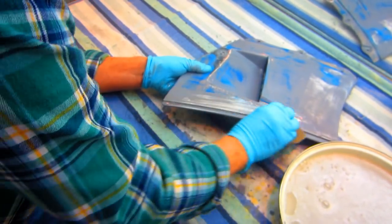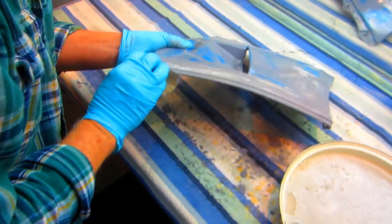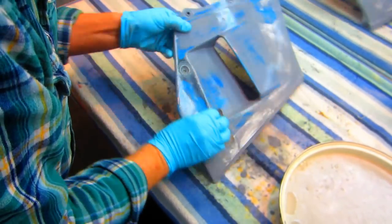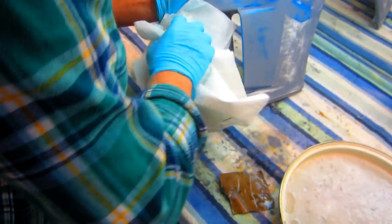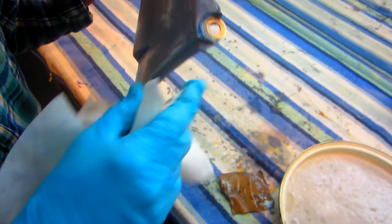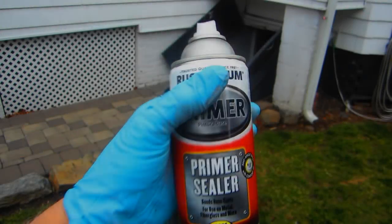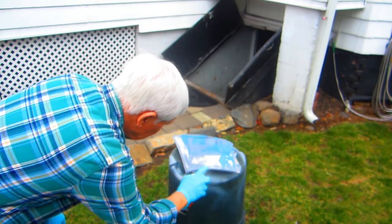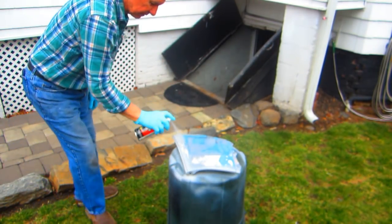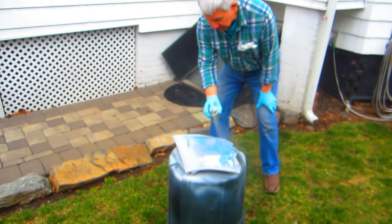He's got to pick up the paint - this is going to be the Walter Wolf paint job that he's mesmerized by. We're going to get a coat on this, and we got the repair done in the front so it's ready for the next coat of primer. This quick test is going to be whether I can go over the Dupli-Color with the Rustoleum without a problem. We'll find out right away - sometimes it takes two, three, four coats to build up that nice smooth finish.